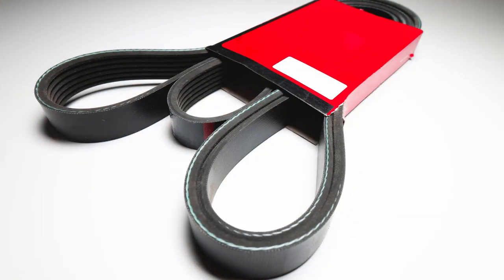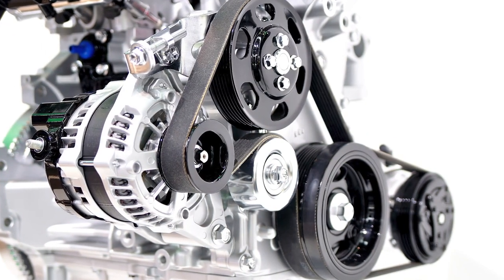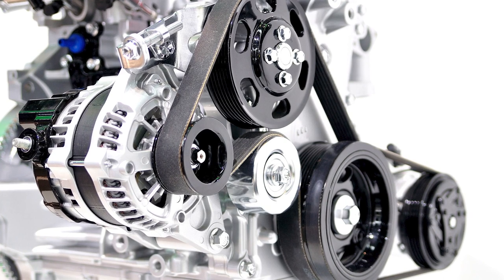Over the years, the automakers have consolidated accessory drive components such as the alternator, the air conditioning compressor, the power steering pump, and the water pump onto one belt. On most late model vehicles, this is the serpentine belt. The serpentine belt, also known as the accessory belt, is part of a system known as the accessory belt drive